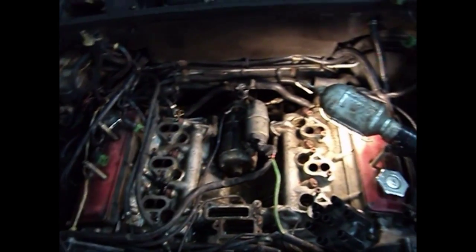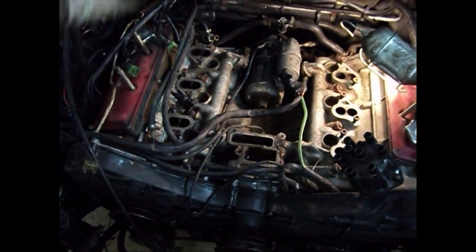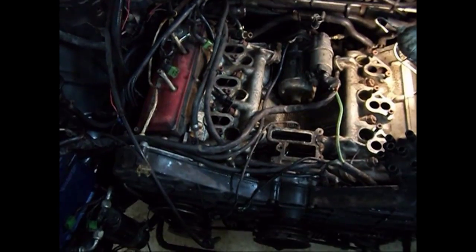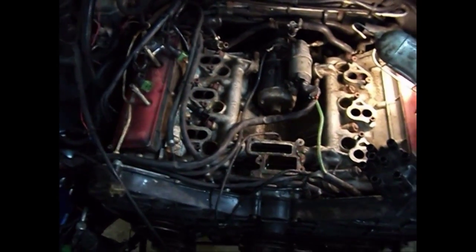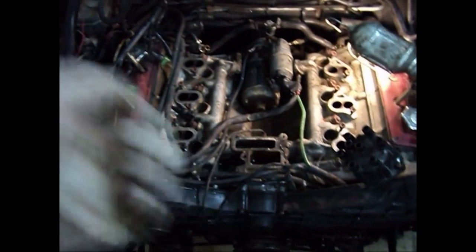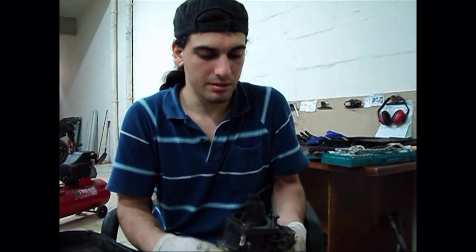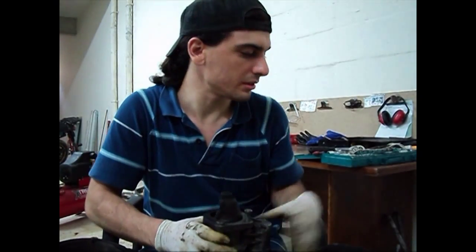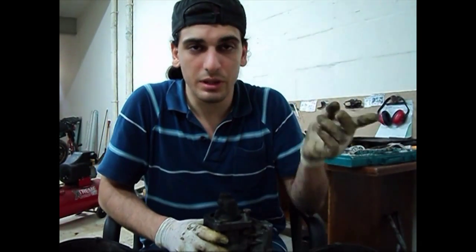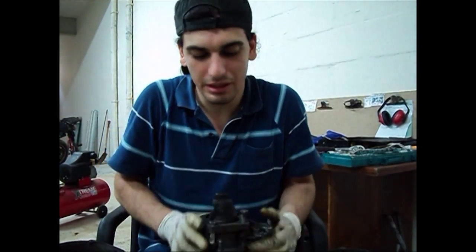I'll slowly be taking the head apart, then taking the other head out, checking the pulleys, and inspecting the bores. This is a wet-liner type engine, so it's all about pulling out the sleeve and pistons — piston first, then sleeve after, which is the best approach. I was going to take apart the starter and some other parts like the battery and covers but couldn't quite film it since the camera battery is still on charge.